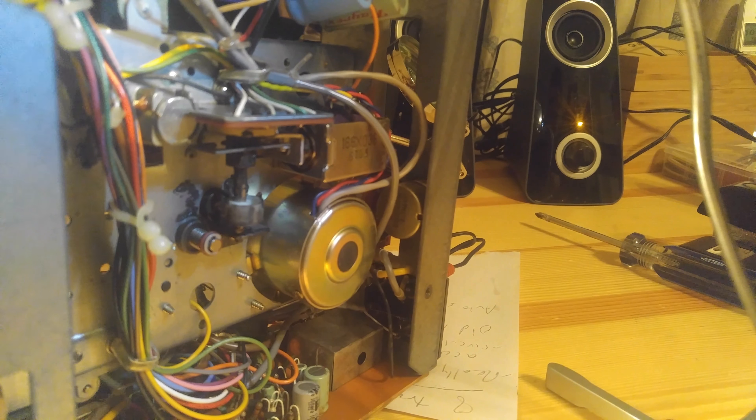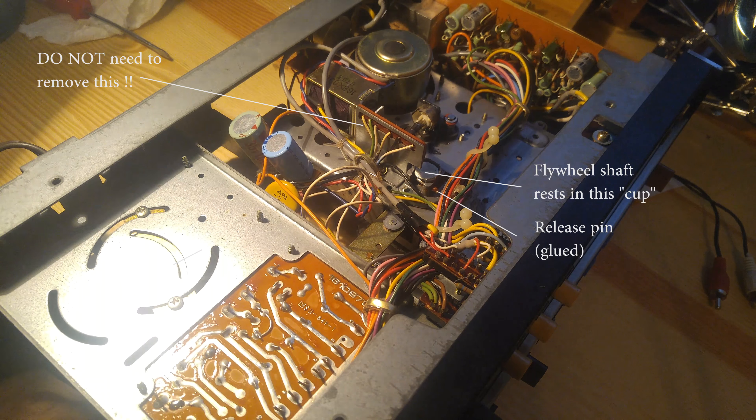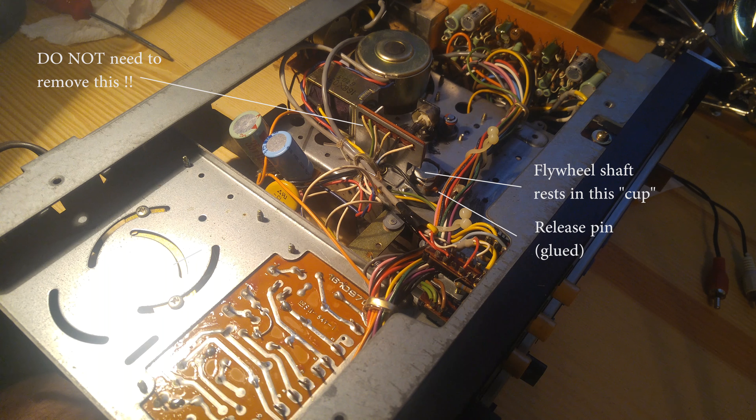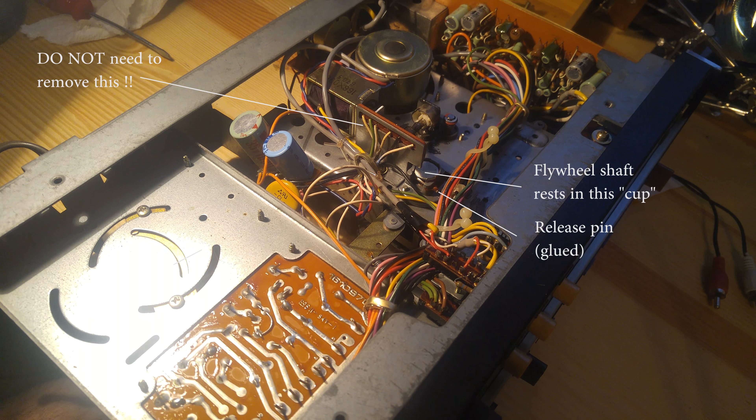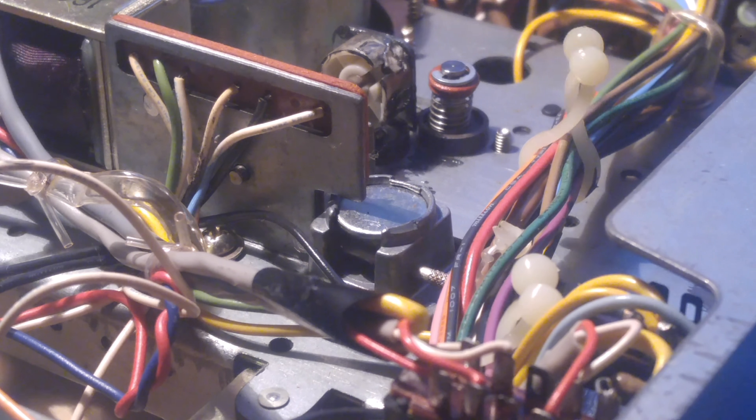The grease just was hard. This piece of metal here is holding the flywheel in — that little silver cup is the bottom of the flywheel. So I have to remove the flywheel. You have to take this pin out, and you'll hear the flywheel drop out once you get this pin out. There's another video that told me about taking it apart — I'll put a link below.